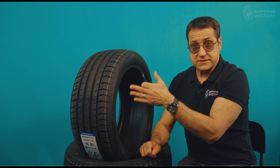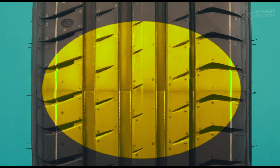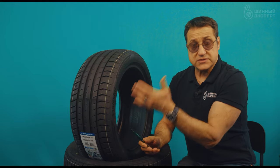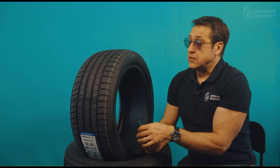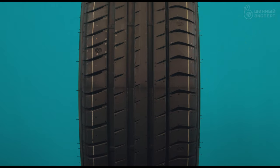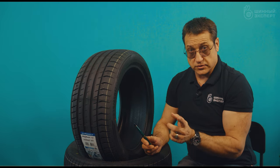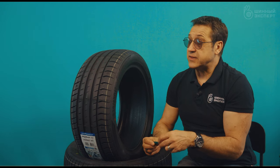The contact patch cord layout is designed to evenly distribute pressure across the patch, so the tire fits more tightly to the surface, giving it better bonding and even wear. For the longitudinal channels — three wide and one narrow — the widths are 6mm, 13.2mm, 13.8mm, and 13.2mm. This is sufficient to channel a large amount of water and combat the risk of aquaplaning.